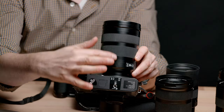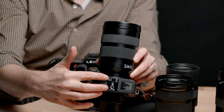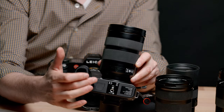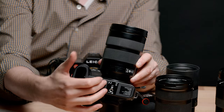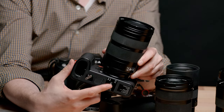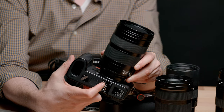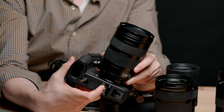You'll notice that this is, obviously with the tripod socket, directly in line with the center of the lens. So what they wanted to do for the image stabilization, which I said is such a great feature, they needed to have a gyroscope. And that gyroscope has to be at the center axis of the lens at the lowest possible point on the camera. Well, guess what? That puts it squarely right where that little hole was. So Leica decided it was better to have really effective five-axis image stabilization than to have a little registration hole. There we go. And that's the reason.